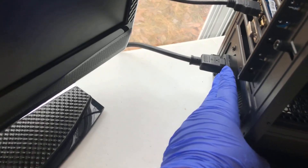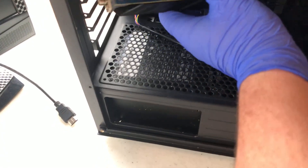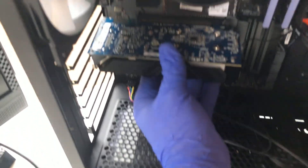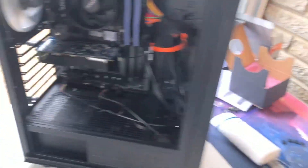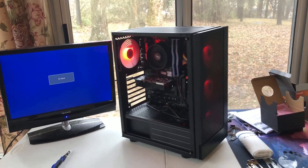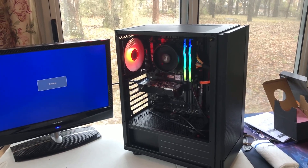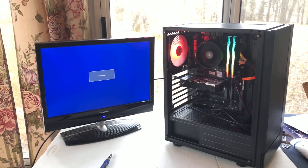Let me just give it a second. Unplug this, unplug the HDMI. Let me unclip that, slot out the GPU, and move that cord out of the way — I'm going to do some cable management. They're probably going to roast me in the comments for not using a bracket for the GPU, but the problem is I don't have one and it doesn't need one because it's super duper light. Let me go get that cable and try this again. Just keep waiting — hopefully it works and I didn't blow up the computer.